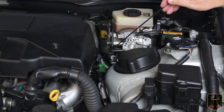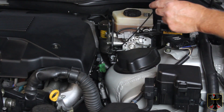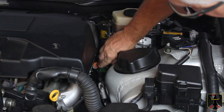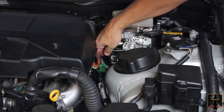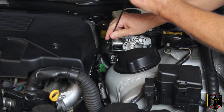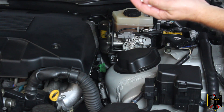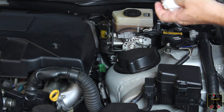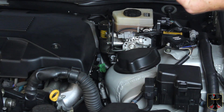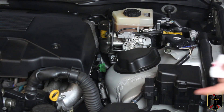Now that we've put it through the gears, we're going to put it back into park and insert the dipstick — I've already cleaned it off. You have to insert it all the way in until it snaps. Take the dipstick out and look at the fluid level for the hot mark right here. It shows we're slightly over, so we're going to suck some out, get it to the right level, and that's all there is to this video.